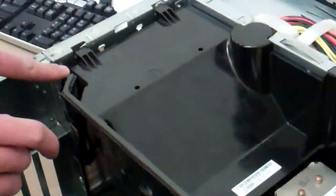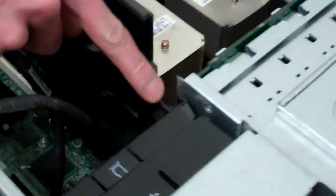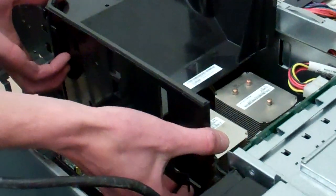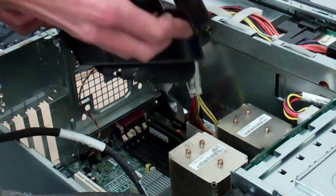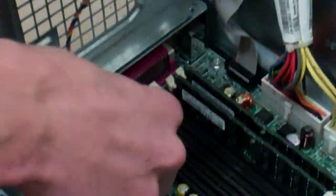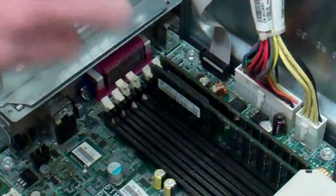There's a release lever for the shroud here — mine's broken, but there would be one here. You would press these down with your thumbs to lift it up. Then unhook the cable down here for the rear fan — it's just a pinch and a lift.